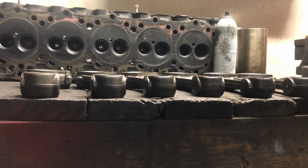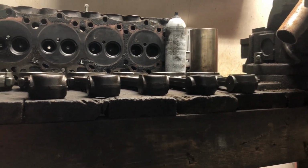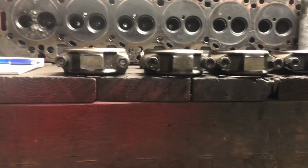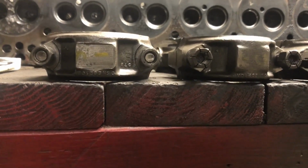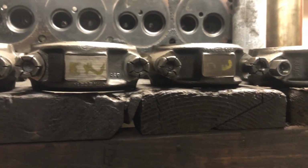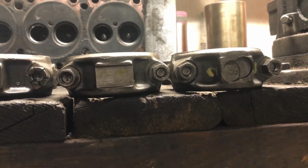And you know, for the most part, they all look pretty good. The 3 towards the vise are the ones that I'm wanting to replace. Okay, I'll flip them over. Okay, and here's where it gets scary. I'm going to go one at a time. See differences? Bolts. The caps look close. Bolts. Caps look close. These two at the end, if you look, caps are completely different. And that's why I don't like this pair of rods.